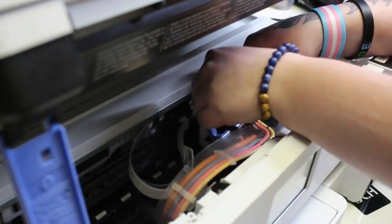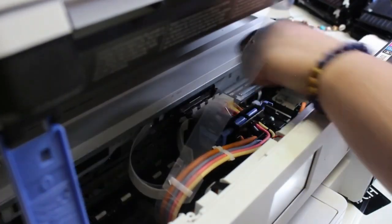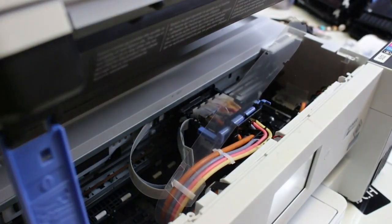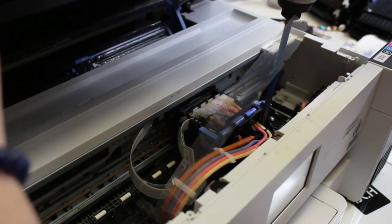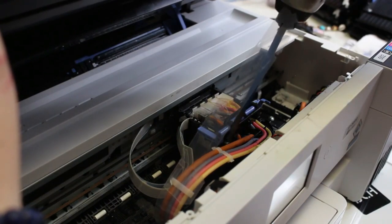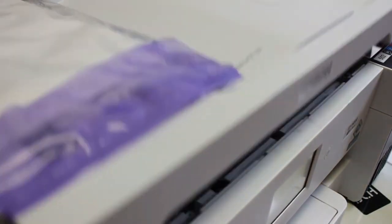What I'm doing now is reattaching all four tubes to the correct damper. Once I have that, I'm going to take the two screws I need to secure the tubes down into place. Again, I have to move my blue support for the scanner to get my drill to fit in there. For me it was easier, like I said, to not take the scanner off — I just don't like risking breaking any hinges on the scanner if I don't have to. There are two screws in here. Once I have that, I'll put the blue support back in: close it down once, close it down twice, and lift back up all the way open.